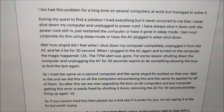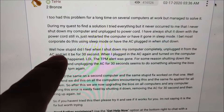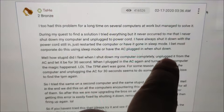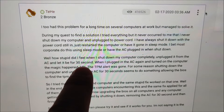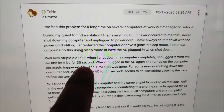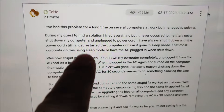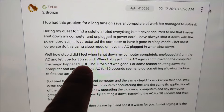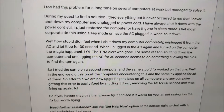So the solution is actually this. It might not work for a lot of people, but it worked for me. I just unhooked the AC power plug and left it for 30 seconds, then turned on the laptop and it booted just fine. So that's probably the easiest thing you can try: unplugging the power cable, waiting 30 seconds, and booting up your Dell laptop. That's all.